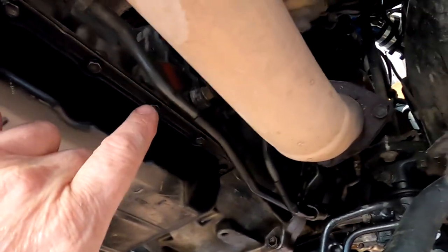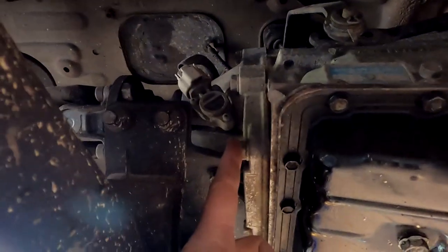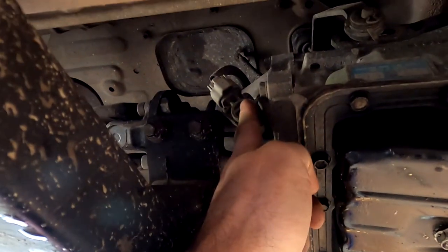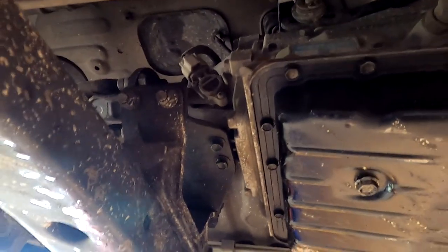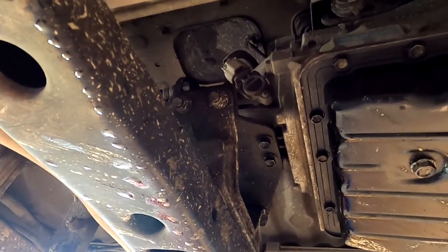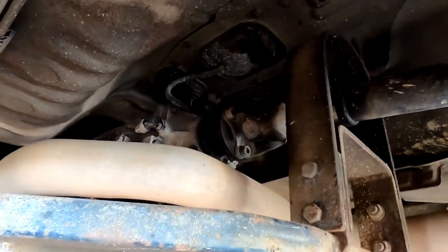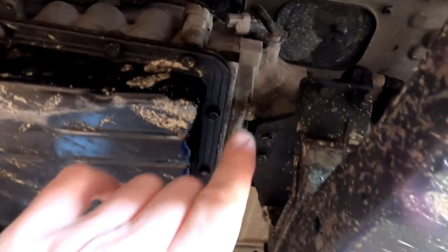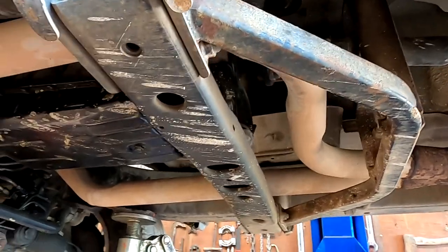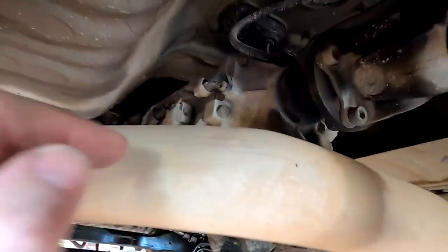It's actually quite smart because they've used the Gen 2 box, but then they've added a Gen 1 tail shaft to it to give the speed sensor. So that's its own circuit as the speed sensor. That's got a Gen 1, which is a bit of a pain for what you want to do because you've now got a drive on it, and you actually want the one without a drive. So I'm not sure I've got the correct one. I'll see what I can find for you, eh? But if guys are doing a vehicle that needs a separate speed sensor, using a UCF 20 engine and box combo, then putting the Gen 1 tail shaft housing on with that separate speed sensor is the way to go.